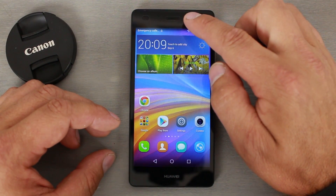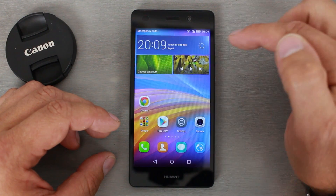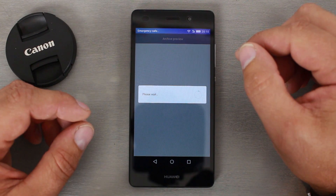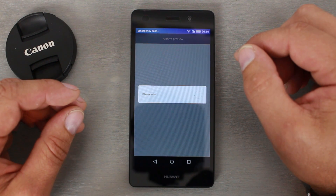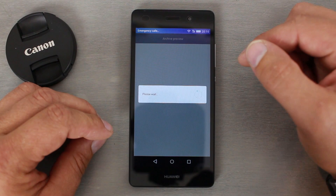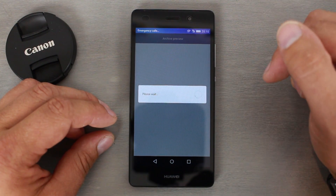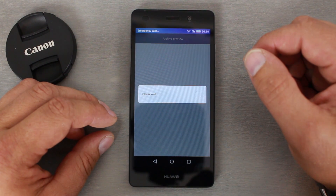I've already downloaded that zip — the firmware — and you're going to open it up. You're going to need an SD card; this is very important. You have to have one for this to function because you have to put the firmware files onto your SD card. It needs to be four gigs or more. I found that on this device my 16 gig SD card didn't work but an 8 gig did, so there may be some variances. SanDisk is actually one of the better ones for that.